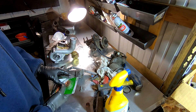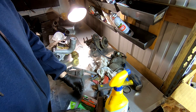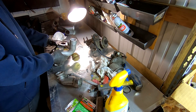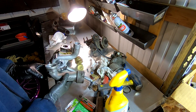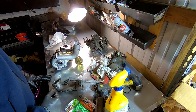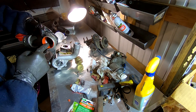I got some of these washers from AutoZone for the coolant line. Putting the turbo in and installing the coolant lines are going to be a different video, but what I want to get done today is installing this elbow onto the turbo. Now, because I ground out the inside, I want to put silicone on it — if you lose any air at this point the mass airflow sensor won't read the extra air coming in and the car is going to run lean. I'm going to put a lot in here because I want to make sure this seals.